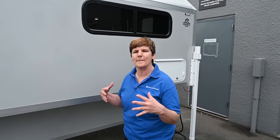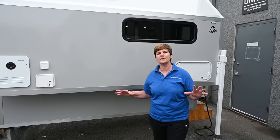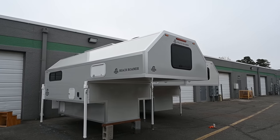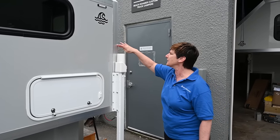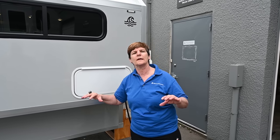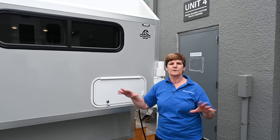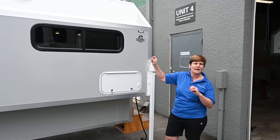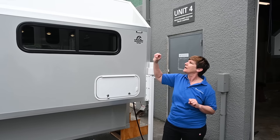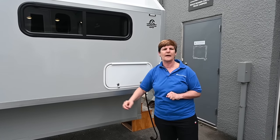Our goal is to make you off-grid. We want you to be able to roam freely and do what you want to do without ever plugging in. What makes this camper different starts with our composite panels, which have an R4 rating, and aluminum ends — not plastic. It will run fully off solar. You can leave your refrigerator on between trips and it has enough power to keep it running. This camper has 600 watts of solar on top and 200 amp hours of battery. Everything is fully expandable — you can add 200 more watts of solar and more battery capacity without any wiring changes.